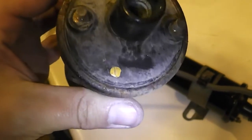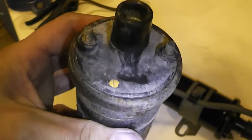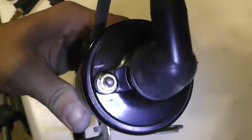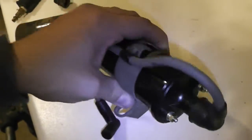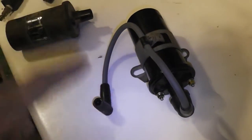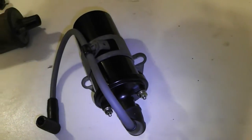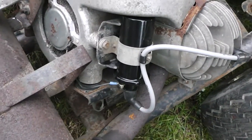Positive, negative. I couldn't see it before, now I do. This here is a factory coil and I think they use a little cheat - that yellow dot, in case the guy has shitty vision, all you do is pick that up and then he knows which way to smack it into that housing. Because I have it the same way it was before. This one's double marked, so there's negative-negative, positive-positive. That's just one little thing you gotta know. If you don't do it right, you're gonna fuck it up. No promises here guys, but it's on. Let's give it a try.